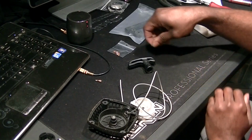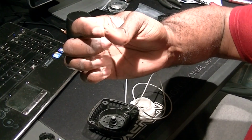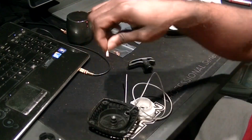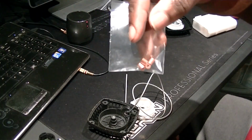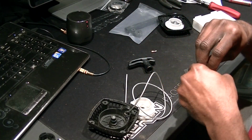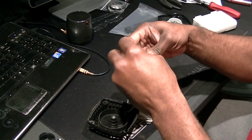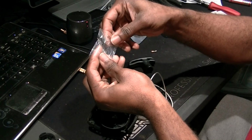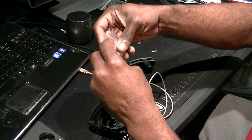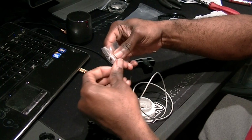So we're going to take this off. Got to hold on to my washer. This is the old piece that was clamped and holding it. Don't need that anymore. Got replacements right here for new ones. When you order the Killer RC steel pull cord, it comes with extra cable clamps. That's what I call these copper ones. Basically, you're going to crimp them with the vise onto the wire. I'll show you that in a minute. So put that right here.